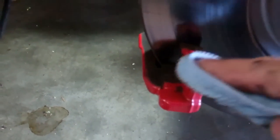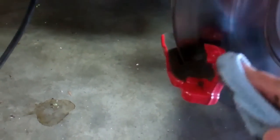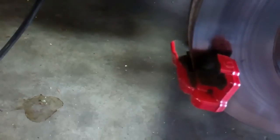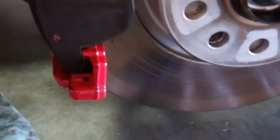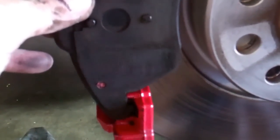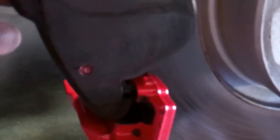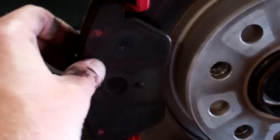It's not too often that you have this apart, so while you do, go ahead and do a little quick clean up. There's no sense in leaving all that dirt there to just corrode and get worse as your car gets older. So polish up all your spots here. You want to do an especially good job cleaning out these little channels here — this is where the pads can slide and move a little bit. You see a lot of build-up and metal and dirt and oil in there. So if you're going to pay attention to anything, clean up these little trays so your new pads have a really nice movement. Make sure there's no binding — it will just ensure a more successful brake job.